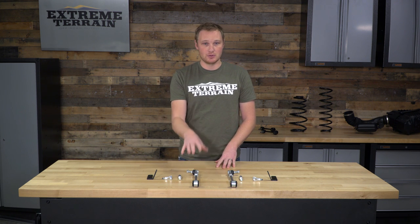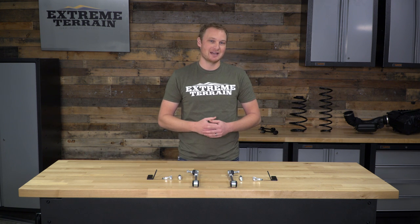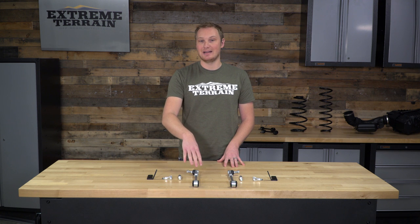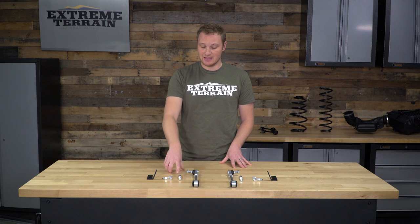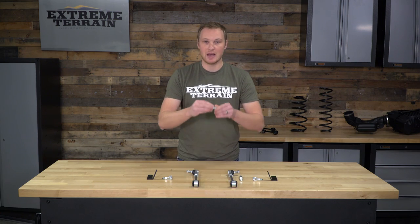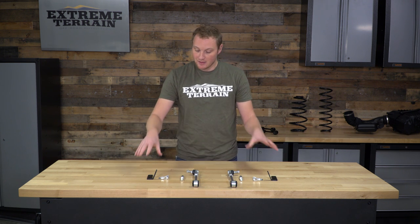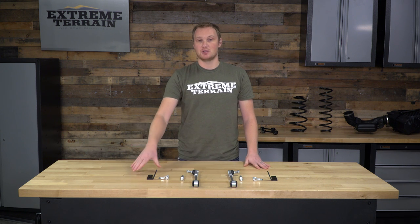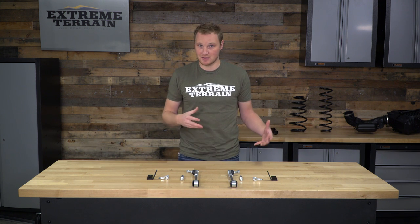This kit is going to include those two adjustable links. One thing that I'm not crazy about on these links is that they're not greasable. If they were, you'd be able to get a little bit more life out of not only the tie rod end but also the bushing at the other side, but this set is not going to be greasable. Also included in this kit is your quick disconnect pin. This is going to take place of the bolt on the bottom side of your sway bar end link on the axle side. This allows you to very quickly and easily slide the bushing end over top and connect it with the included pin. The kit also comes with a storage bracket, so when you swing that sway bar end link up out of the way, you have somewhere for it to stay so it's not going to get bound up in the rest of the suspension.